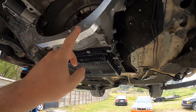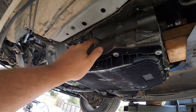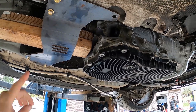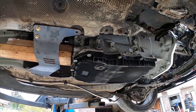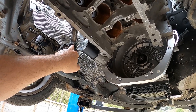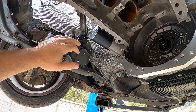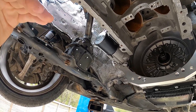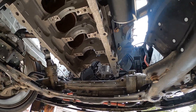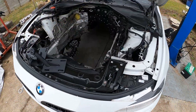We've got the Guru Auto Works 8HP adapter and the 8HP70 — this is a Dodge Durango or Dodge truck style. According to Josh the only difference is a tow tap hole. It fits pretty good. We'll make a new crossmember to use the Dodge mount. Driveline angles look good — if anything we need to go up with the motor slightly, which is easy by spacing the motor mounts up. We'll get the 302-2 pan in there physically once the new combination is together, but it looks good in CAD.